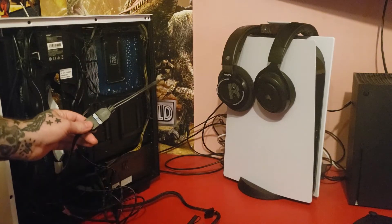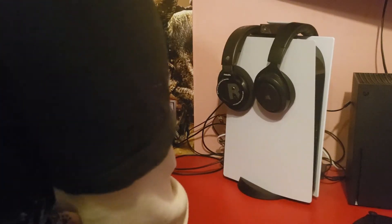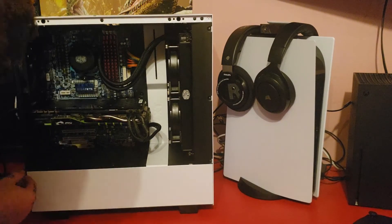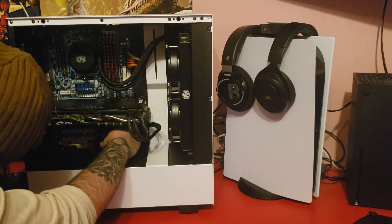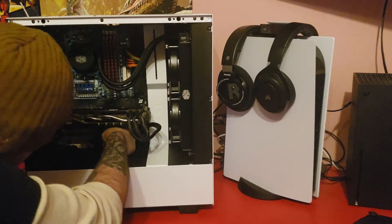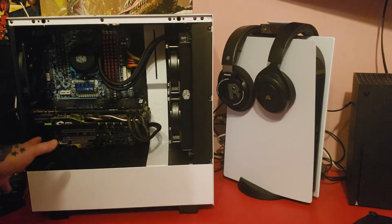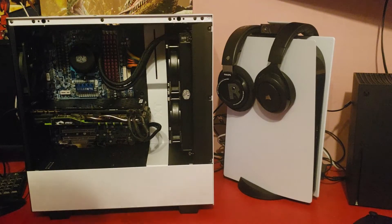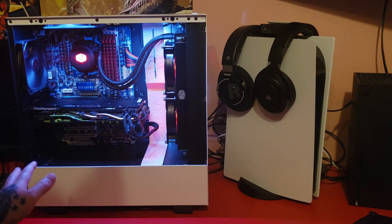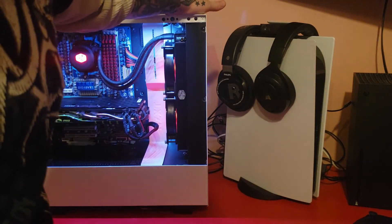The next step will be plugging into your motherboard, which is on the front. You want to cable manage all this back the way I had it — just shove it in here, back to the front of the PC. It's pretty business as usual: find a USB 2.0 port, which should be plenty on your motherboard — at least two. Plug it in the way that the pins line up. Now, this adapter does not have a key, so you can plug it in the wrong way, so just remember that. Make sure all your pins are counted and all line up, then you can plug it in. Once you get that, double check everything, check your cable management, put the computer back together, and the USB port should work.